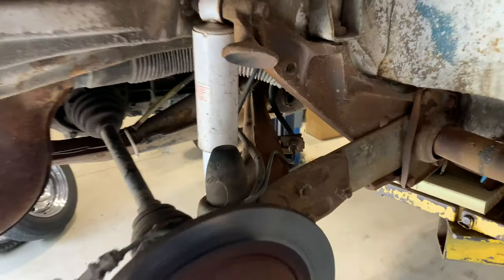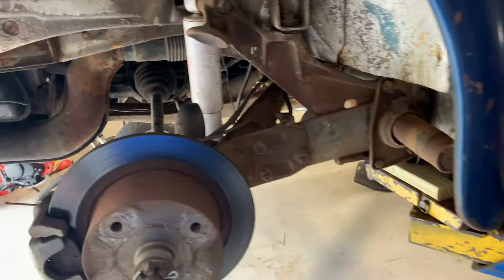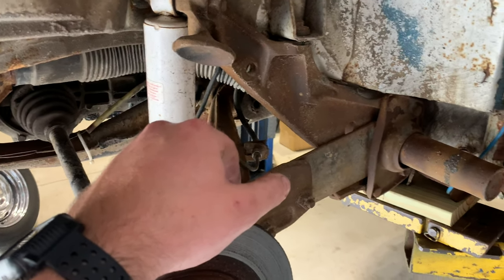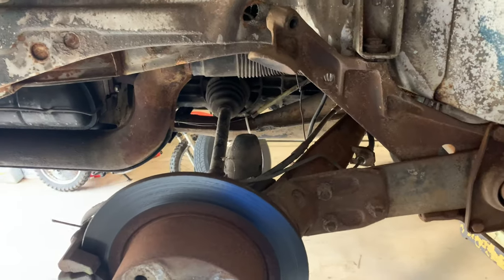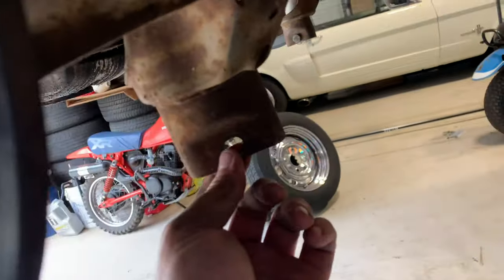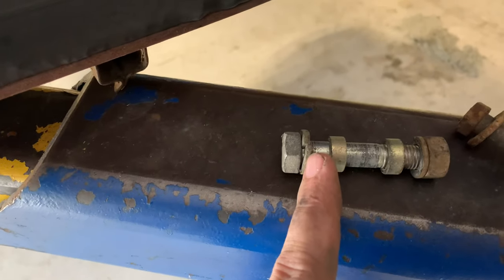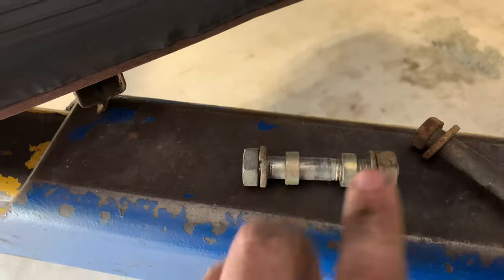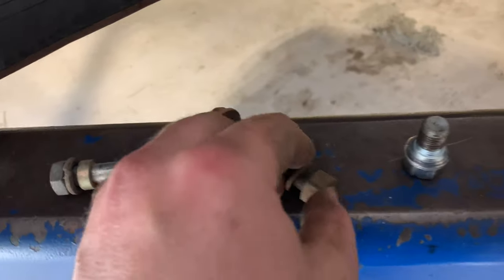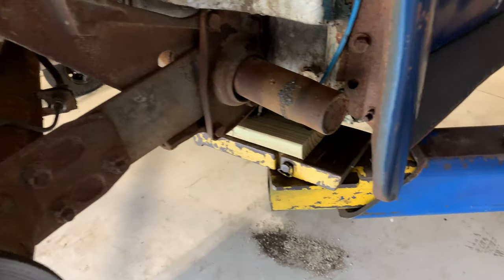Some people just remove the bump stop all the way, which is fine too, but I want it to be low — I want to be able to go all the way down. Removing the shock, you've got some spacers in here and a flange here, another one on the other side. The flange goes there and there, and this one has a lock washer on both sides, then the spacers, and the shock fits in between. The front is just a washer and a lock washer. Not sure what's original or what came with those shocks, but that's what's on there.